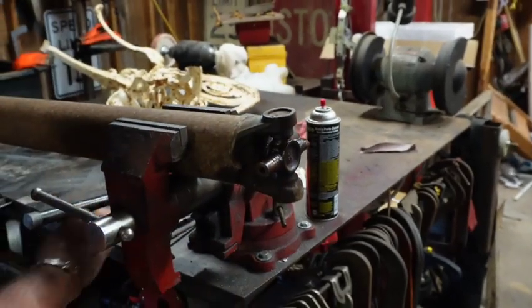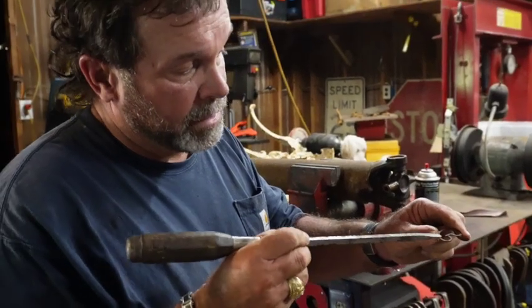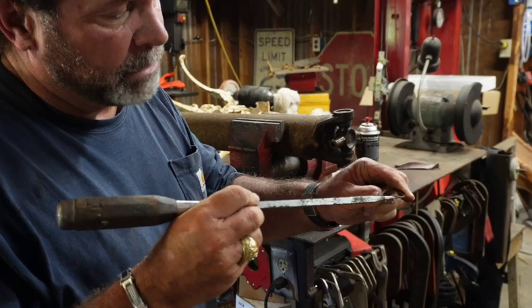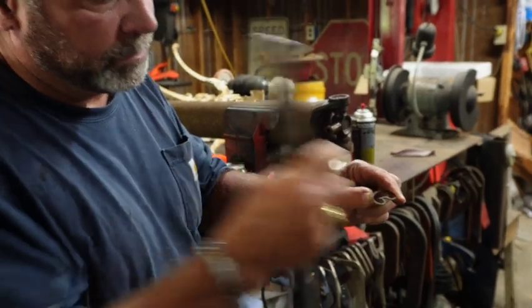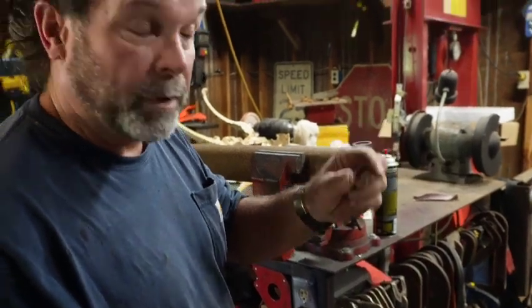Alrighty guys, real quick what I did, when these things get bound down, you take a large enough screwdriver and drive in under here, and it'll do two things. It's obviously pinching these together, but at the same time, it's lifting the back side up. All you got to do at that point is hold it with the screwdriver in that position and grab it with the needle nose and just pull straight up on it, and these little clips will pop right out.